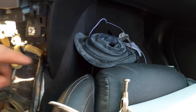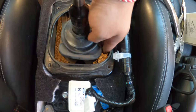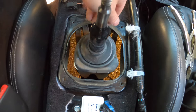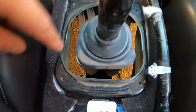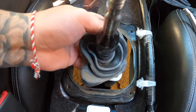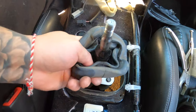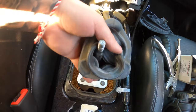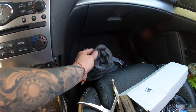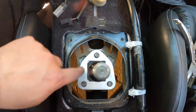Now that we've got that part off, there's another boot — this one's pretty easy. Just grab around the corners and pick it up. Now you can see right through to the ground, and we will need to be down there later. Use your muscles for this — go on and pull it off. Now take off these three bolts, which should be 10 millimeter each.